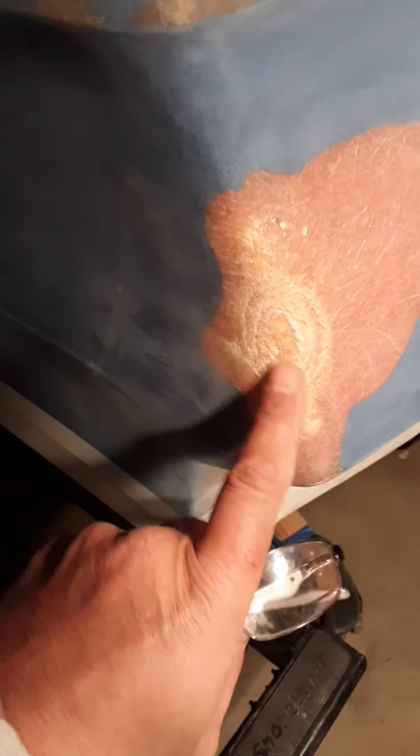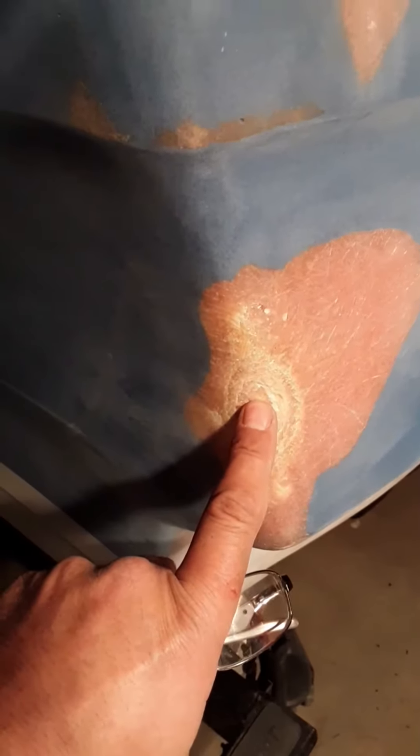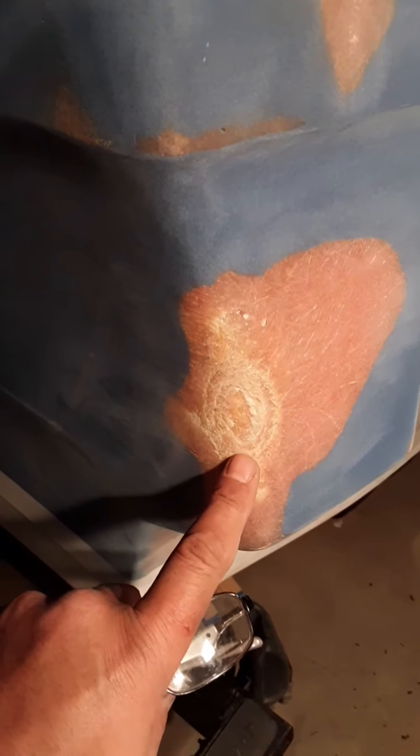Because now I've got a concave there. When you're trying to get rid of an imperfection, you want to sand until you see pink and not yellow. When you've got many different layers, it's hard to know where that stops. I can certainly see solid right here in the middle, and I can see different rings of different layers of fiberglass from the manufacturing process. There's no way to get that yellow out.